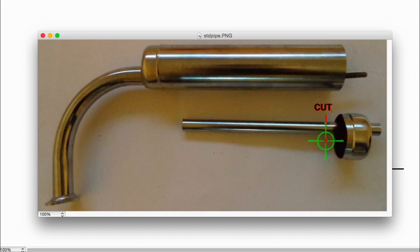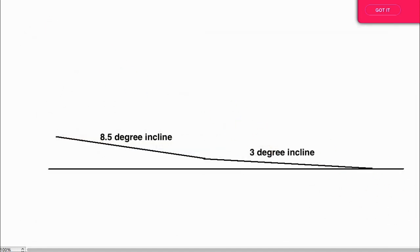I went home and cut some of the internal part of the pipe. The design is that exhaust goes through a long tube with holes in it, then through some baffles, and then into this area where it exits. By cutting that tube down anywhere before the baffles - about halfway along - the exhaust is able to completely avoid those baffles, which means better flow.